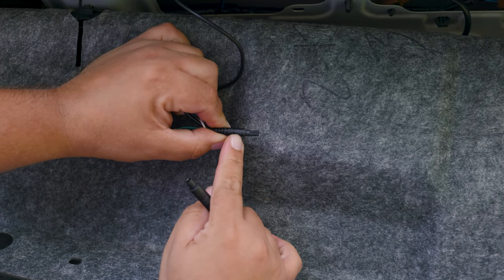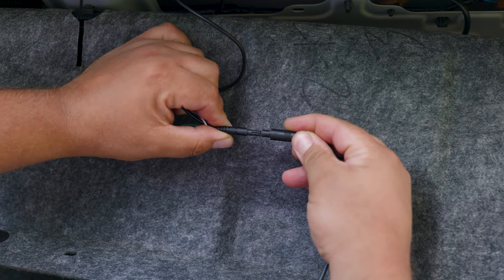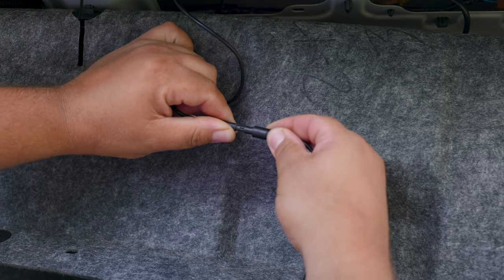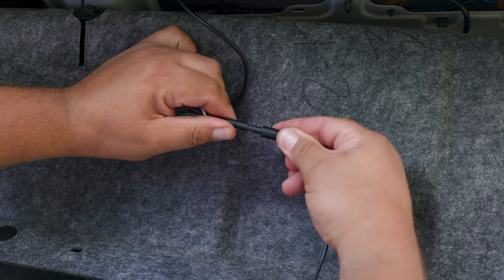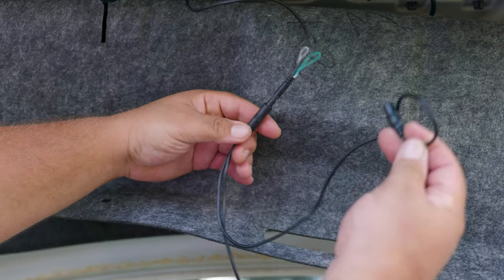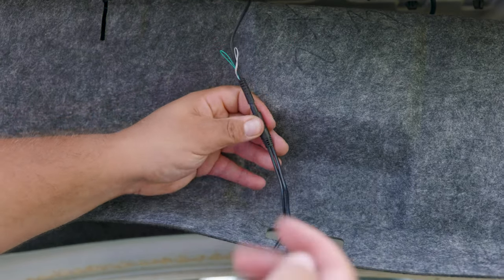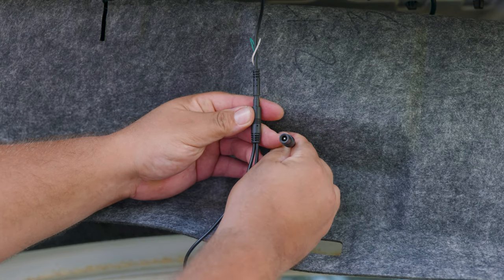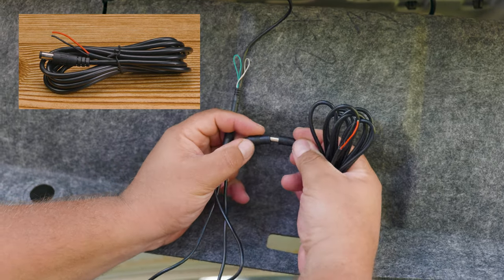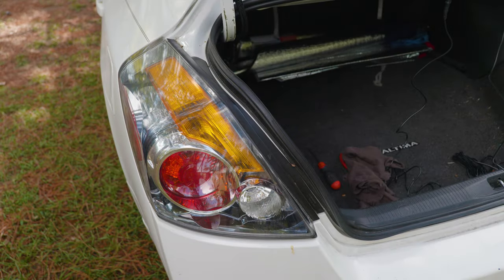Since we're choosing to show both ways, we're going to connect the one for the backup light — the one with two wires coming out. We take the wire coming from the camera and connect it to the video wire, aligning the two arrows that point to each other and then inserting. We'll now have an additional cable hanging from the video connection, which will be the power source. We connect that additional cable with the open ends together.